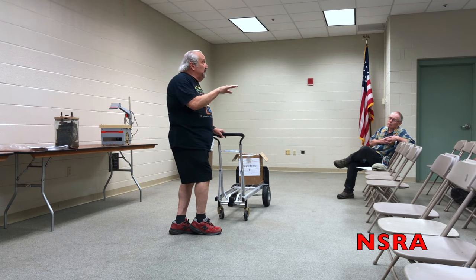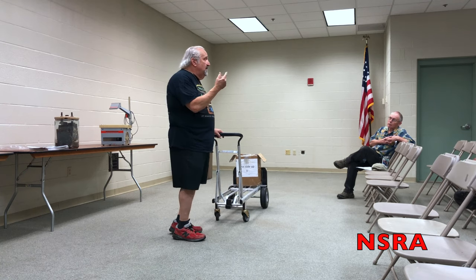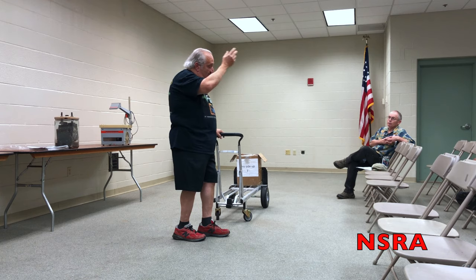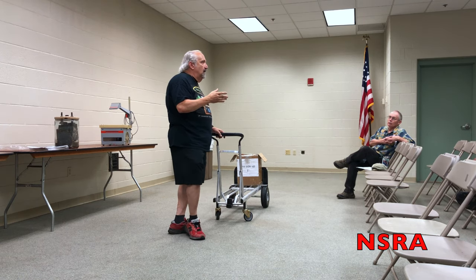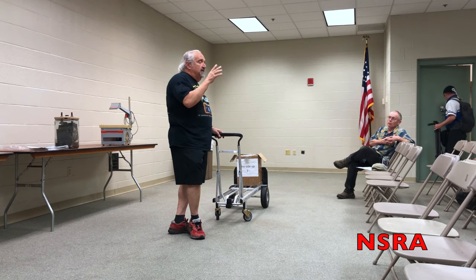AGM batteries, like the Optima and stuff, a lot of customers have Optimas, are also better for vibration. But short of the vibration and the fact that you don't use the battery and you want it to last, and you're gonna leave it sit and not gonna plug it in, or you can't plug it in, AGM batteries are twice as much money. So dollars and cents wise, I've got a couple cars. And let me give them another point. They usually have more amp hours, about 100 more amp hours. So if you've got a high performance car, I've got two Optima batteries, then you might want that.